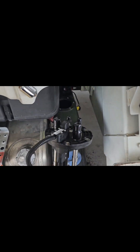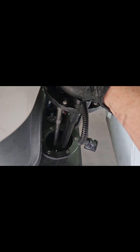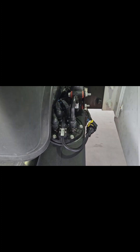We're just going to set that out of the way and get our new header. Here is our new DEF tank header ready to go in. Went ahead and cleaned the sealing surface because there is a gasket. Good tip: it does like to get pushed out on new parts, so go ahead and push that back in to make sure it doesn't get pinched. We're going to put the bottom in first. The little filter at the bottom can be a pain — you just have to move it inwards to clear that gap. Right in the middle it's going to give you a little bit of tension, just go ahead and pop it down. Pull the tank over to the side — this is where loosening your tank really helps. Push that line out of the way and we are fully seated.